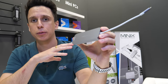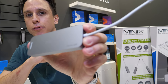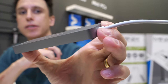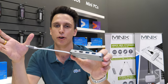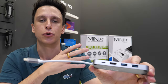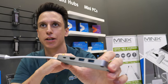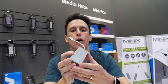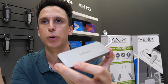It's fully compatible with the MacBook, MacBook Air, MacBook Pro, and also with the upcoming release of iOS 13 — it's fully compatible with the iPad Pro. Compatibility is also dependent on the operating system and hardware. If your Windows laptop is equipped with a USB-C port that supports data, display, and power, it will be fully compatible with Minix Neo Storage. These come pre-formatted to exFAT, which supports both Windows and Mac.